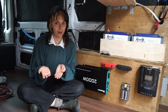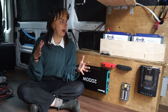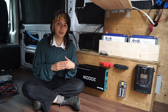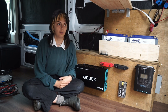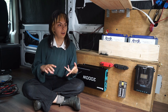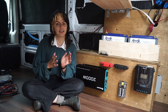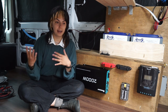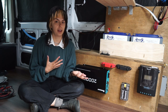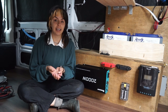You need to figure out what is best for you and go from there. But I also feel like a 400 watt, 200 amp hour battery system is really good for an individual person in a van, and maybe even a couple. After doing research on how much power I needed, I started doing research on what products I would want to buy. I highly recommend buying made-in-the-USA wiring if you can, and also marine grade products. A lot of stuff people use on sailboats translates really well for RVs or camper vans. Marine products are also graded to withstand corrosion and weather, which is very useful for a van, especially if your system is going to be exposed to weather.